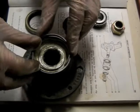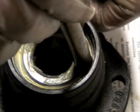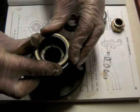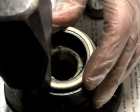Put the hub assembly on your workbench with the inner bearings facing up and push the snap ring back in. Use your drift or punch to gently tap it in against the back. Next, add the grease seal — same idea. Use your hammer and gently tap it in evenly, forcing it down against the back of the inner bearing all the way around. It's meant to keep all the grease in — hence the inner grease seal. Always use a new one; don't reuse the old.